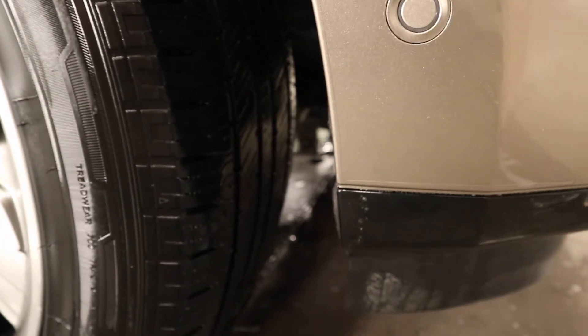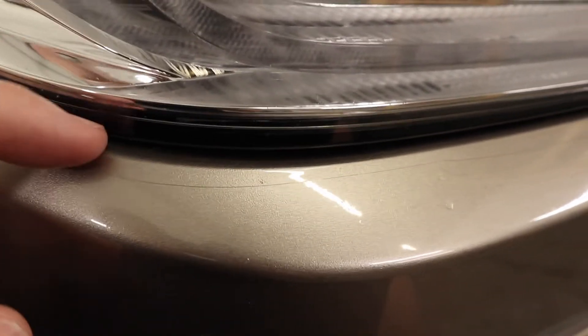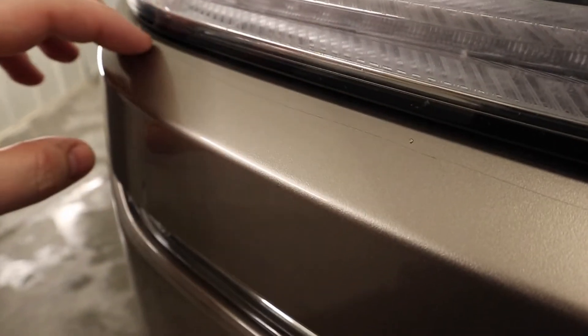On the bumper, there's a good solid half-inch gap where the film stopped — it's barely wrapped around at all. Coming up along this top edge, you can tell this has all been hand-cut and not done carefully. You've got one stone chip there where the pattern should have come up higher, and over here there's a jagged cut mark and a stone chip that actually damaged the bumper. My guess is the top edge wasn't properly sealed, dust got underneath, and they just took a knife and trimmed it back. There's a standard relief cut over here which is normal, but you can definitely tell this was all hand-cut instead of using a proper pre-cut pattern.